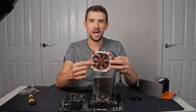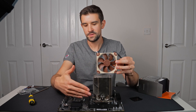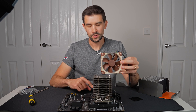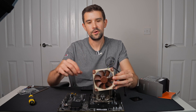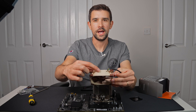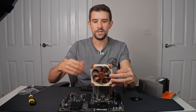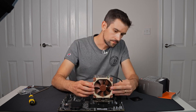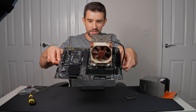It's important to remember the airflow — what we're looking for is air to flow through the case from front to back. These are the ports that you'll connect on the back of your PC, so you want the airflow to come in in one steady state through. On the fan it's got an arrow on the top, so you can see that we want the airflow going this way through the system. I've now attached the CPU fan and it weighs an awful lot more than it did.